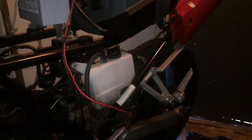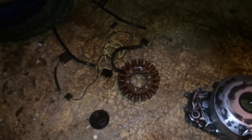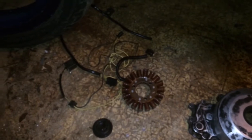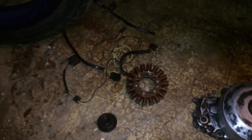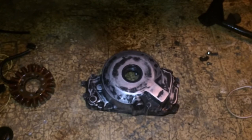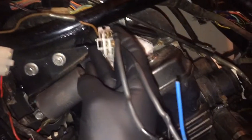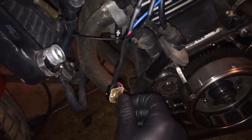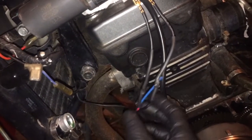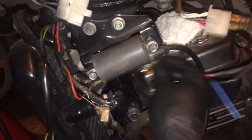Anyway, back to the no-spark issue — I'm going to have to get brand new parts or find parts that test out properly. Once again, this is my '97 Kawasaki Ninja project. I did make a custom ignition switch: stick it in the main big white wire and the middle red and blue wire, ran it down to a simple switch, heat-shrunk everything down, and I'm planning on mounting it somewhere hidden on the bike.